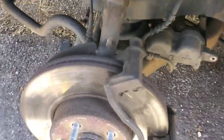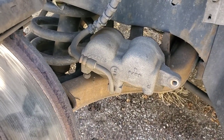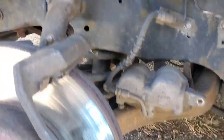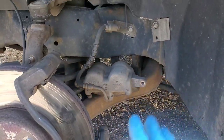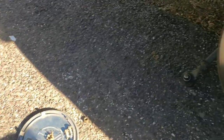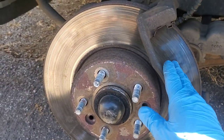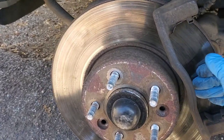So I got the brake caliper off and the pads out. I went ahead and just set it there on the lower control arm for now because there's not really a strut or anything to hang it on, and it's kind of hooked in behind the frame there so I don't think it's going to fall. It's definitely good that we were replacing these because these were pretty worn down indeed. Luckily the rotor's not all screwed up on the back side — these things are almost certainly warped a bit, but it's not going to tear up the new pads.